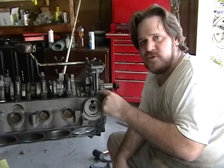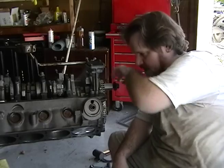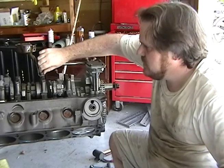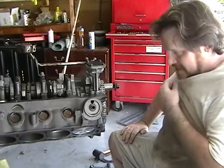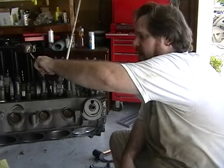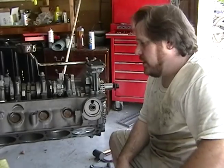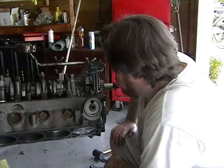This is aligned properly. We set these both to 18 foot-pounds. There's thread locker on these bolts right here - the pickup to the pump. Put thread locker on this one, and ARP ultra torque assembly paste for these fasteners. These are bolted to what I think is about 32. No way for me to check this, but it's pretty tight considering how much leverage I had. So we're done with that.